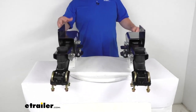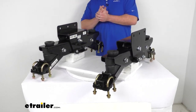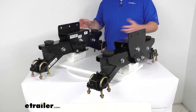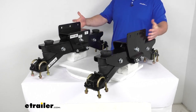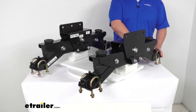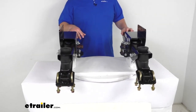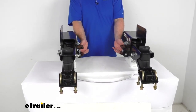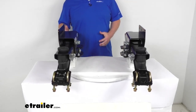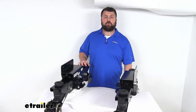As far as installation, it is a bolt-on installation. The mounting hardware is not included, so you will need six 5/8-inch UNF bolts with lock nuts and 5/8-inch washers. You are going to have to do some drilling and welding — you'll need to weld axle seats to your axles, and you'll need a 2-by-4-inch hollow steel crossmember to connect the two units together. Overall, it's a pretty simple installation. It takes some time, but it will give you quite an improvement in your ride quality.